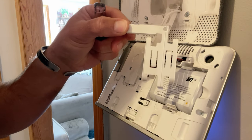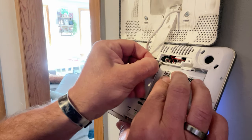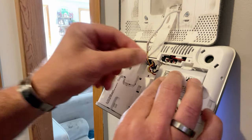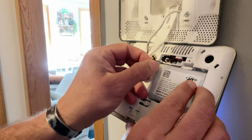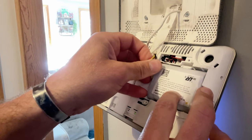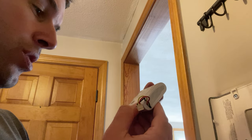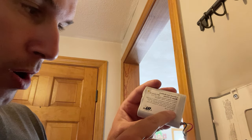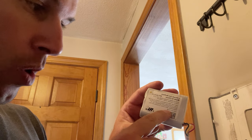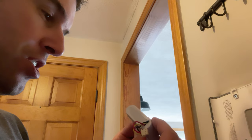This is the piece that holds the battery in place. Disconnect the battery from the circuit board — easy — and it literally comes right out. When you get the battery out, it's important to note the part number. It's right here: part number 300-10186. This is the battery pack in mine.